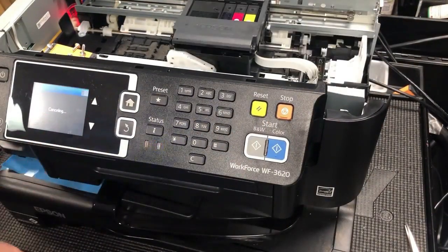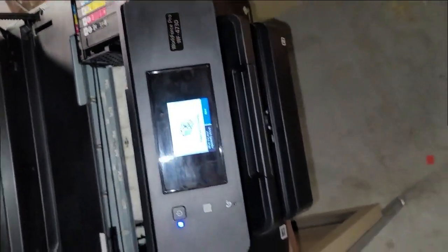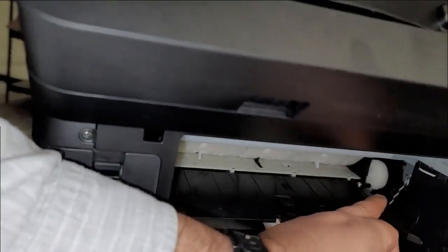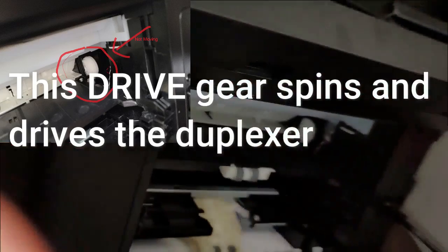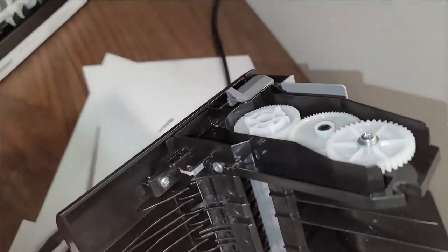He took off the back of the printer and here's what he found. Hello, Kevin. Thank you for your email. So I'll just show you first what the symptoms are. This is the message that's coming up. I've used the second tray and made it dummy to the sensor so I can see what's going on at the back. So those are the wheels that I thought would spin so that the duplexer gears would catch the paper.